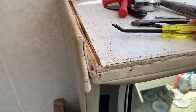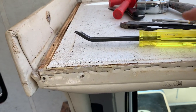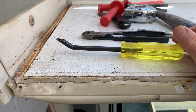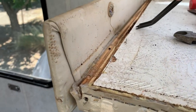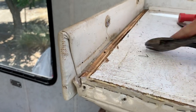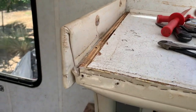You folks that have watched my other videos — on pulling carpet when I redid my truck camper, or any place where there's just a bunch of staples — this little tool right here is key to getting this done quickly. Then just get a pair of wire cutters or some needle nose pliers. Once you get in here, it really does make quick work out of it. You can see just even one-handed — pull one side up, then go back with your wire cutters and grab them, and just go along the whole perimeter and get all the staples out.